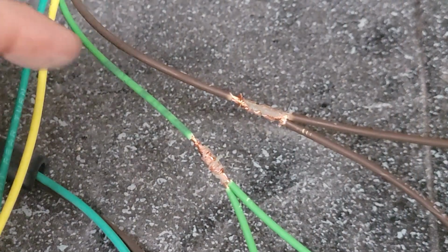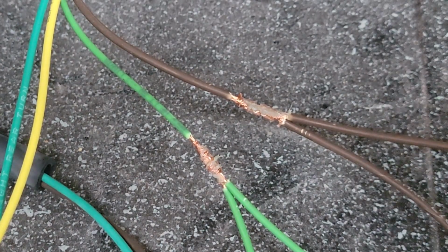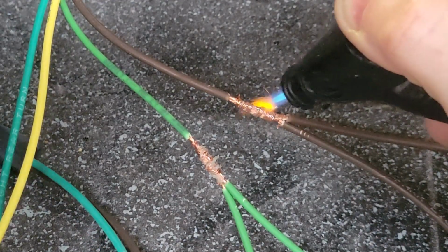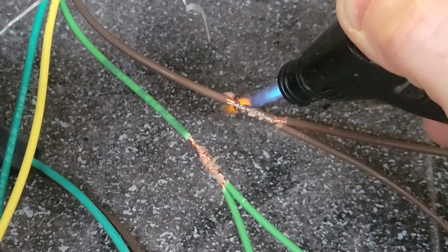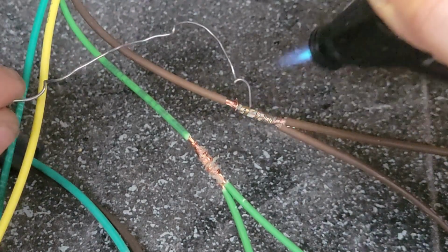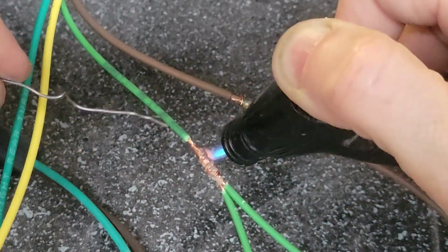All right, so again, strip, stab and interlace, and wrap with a piece of wire, a little bit of flux, and my little lighter torch, mini torch. Heat it until the copper is hot enough to melt the solder. You don't want to flame the solder, you want to melt the solder. There you go, it's tinning it. Getting close. That one's good.